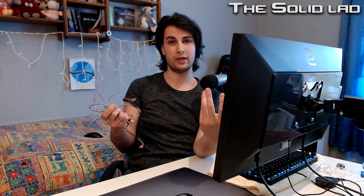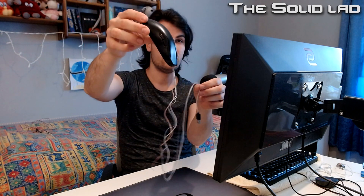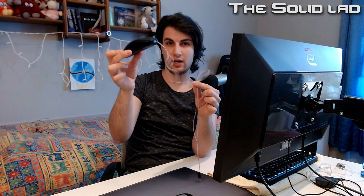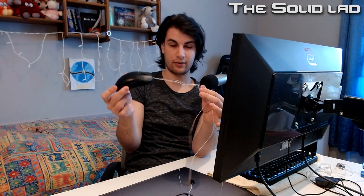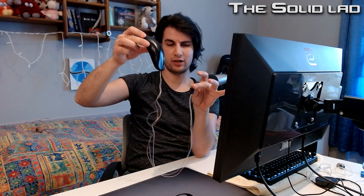However, if you don't want to spend as much, you can just order one of these cheap cables from eBay or AliExpress and do the mod that I've done to my mouse. You'll get an even lighter cable than a paracord because it doesn't have a fabric layer on top, and you'll save some money. The downsides are this will be more fragile than a paracord and also shorter, so you need to use a USB extender cable.